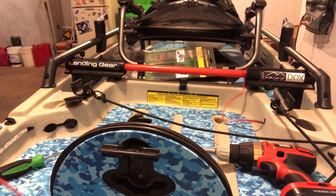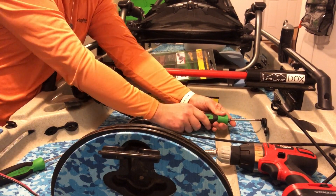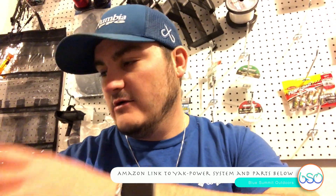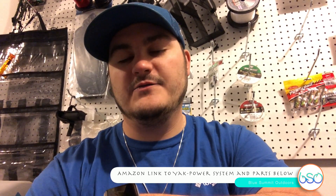That's all you have to do. Just make sure you do that when you plan on putting the battery box way back here and using this kind of plug that you drill in as an extension to run your batteries in the back — make sure you flip those. I hope this helped. Do not forget to flip those and make that little adapter; that was basically the whole purpose of this video. I like how compact the switch is, how basic it is, how nice and easy everything is to plug in with the SAE cables. It's a good system and I hope you guys check it out — links will be below. See you guys in the next one.